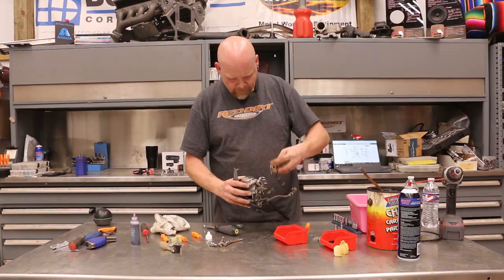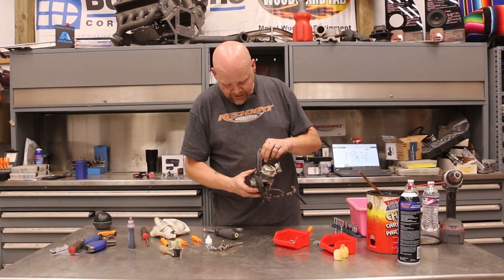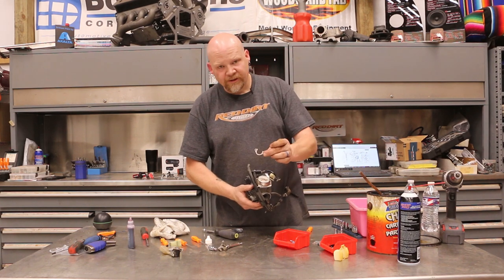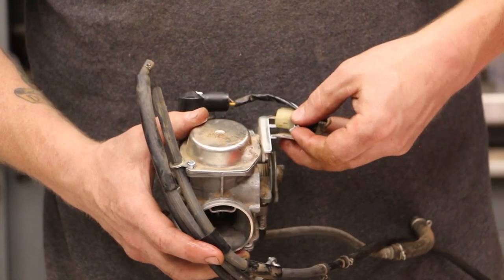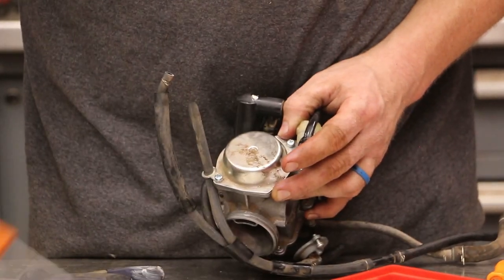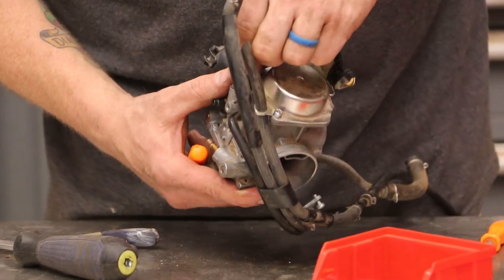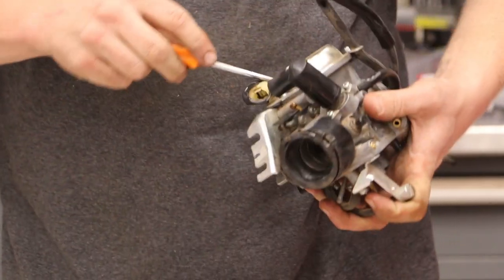This piece is in good shape — drop on there to keep it lubricated. Then this slides in here very carefully — you want to make sure it lines up. That piece probably didn't have to come off, but we took it off. It's got this little horseshoe clamp that rolls around. Then a new screw on the top for the connection — for the pump piston, that's what this is. Lightly thread that in. Now these two I don't think we needed to take those off, so I'm going to go ahead and reuse the original screws. Now I'm going to go ahead and tighten these.